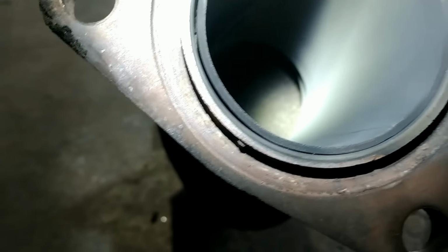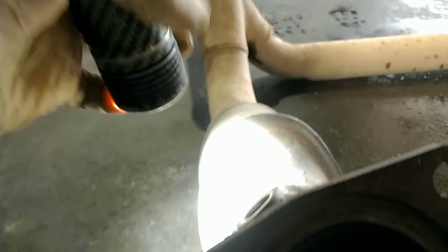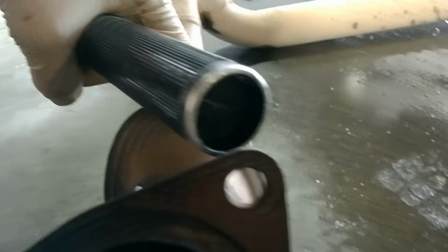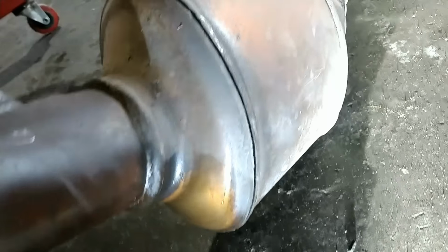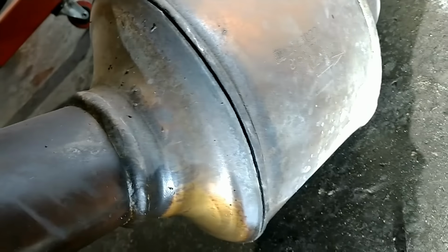And my micrometer detects that I've got about a quarter inch from my weld spot to where the core starts. So I think if I weld heavy on the face, I can avoid melting the core. But my guy knows the risks, and this is what we want to do. And that's what they pay me for.